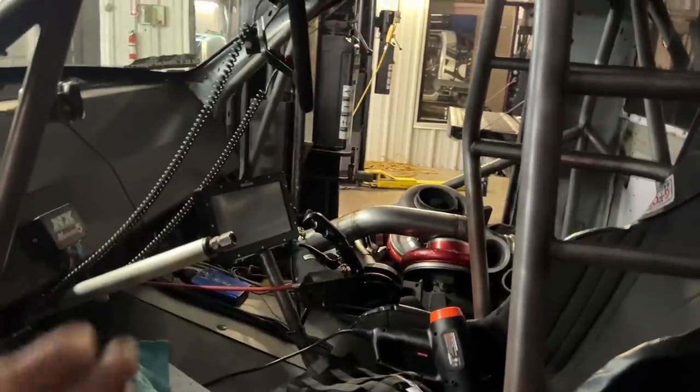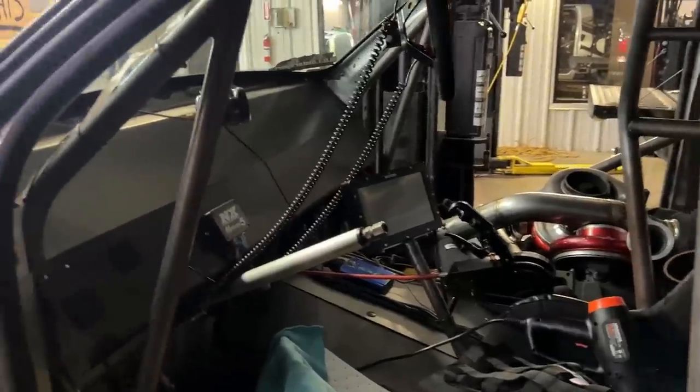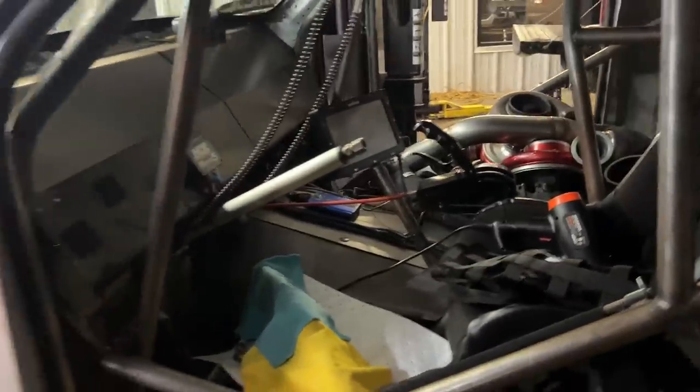He got us set up with a PCS controller there, one of his valve bodies. So now when I put it in manual third, it's first, second, third, overdrive lockups, all computer controlled. And the nice part is he modifies the valve body. So when it's in drive, in first gear, it's actually manual first. So the low reverse band is on. I am really looking forward to seeing what we can do with this. I hope I finally get to use my parachute.